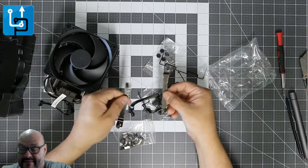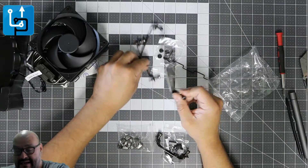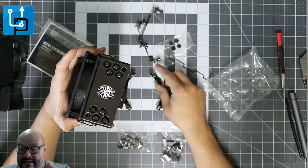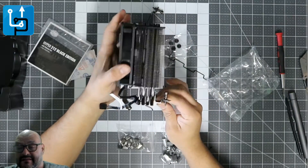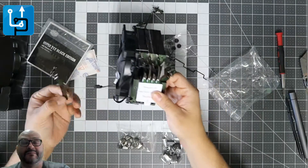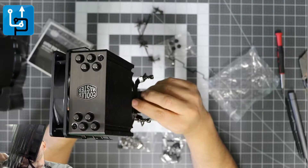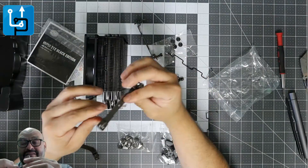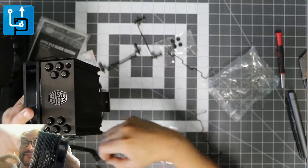Here's the main part. These go on the side — you put them on the side and there's a middle one. These are the AMD ones you need, and then one goes across from it. It grabs on through here, and once you make contact you lock them in. From a bird's eye view, there are two screws you plug in. For AMD the formation is a little different — it has a slot that grabs on and they're a little wider. This part here is for Intel.